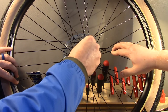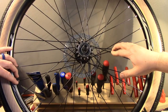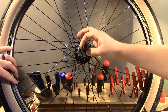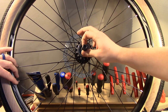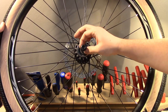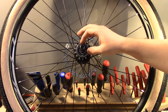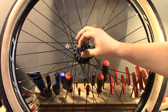What's going on with the hub? Pretty much the hub is loose, and even when we rebuild it and get it to tighten up again, the cone and cup design here — we just can't get it to tighten up enough to technically be fixed. So we've got cup and cone style bearings here, not cartridge bearings. These are going to be angular contact style bearings, which is what we talked about that went into the headset on a couple of other videos. Let's crack this thing open and see what's going on with it.